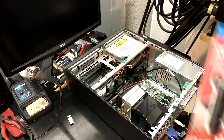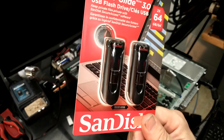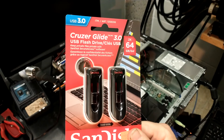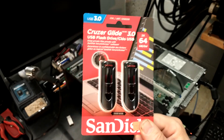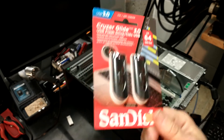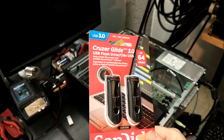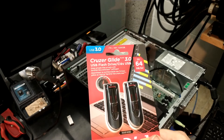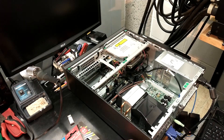It's very simple. Next, we need USB 3 USB sticks to install to. Do not try this with a USB 2 USB stick — it will not work. I spent a year and a half and hours and hours failing every time because I was using the wrong USB sticks. These are very inexpensive. I buy these SanDisk drives at Costco, two for twenty bucks. You may want larger sticks if you need more storage, but I found 64GB is a good start — I can put a lot of retro games on there.